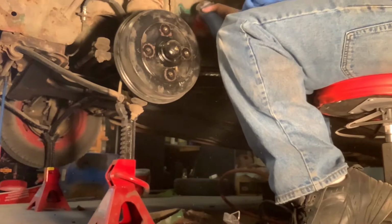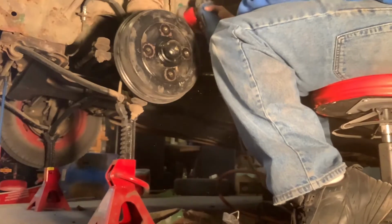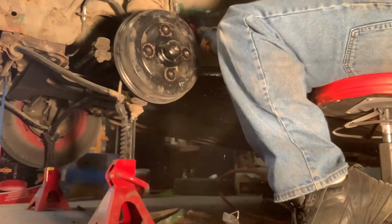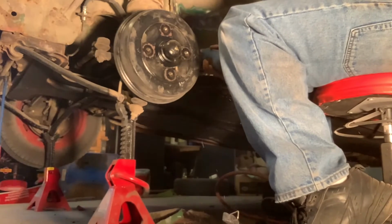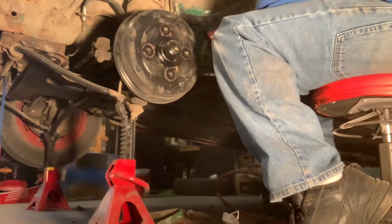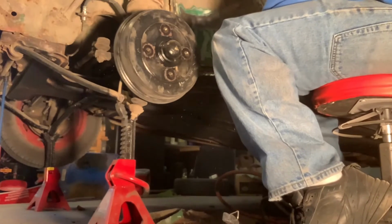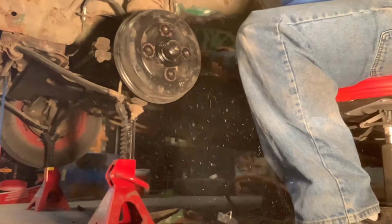And I'll weld it across the top, and I'll weld it down the sides. And I did a little bit of plug welding in the middle, just sort of trying to bond the two pieces of metal together really well. What I mean by plug welding is I drilled a few holes into that fender well patch and welded through the holes right into the other one, so that it's sort of like a rivet, holding it together. It's a lot like spot welding.